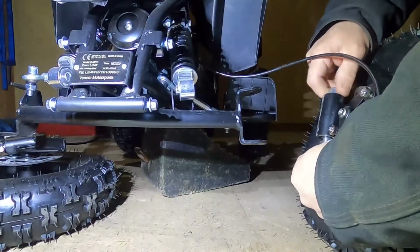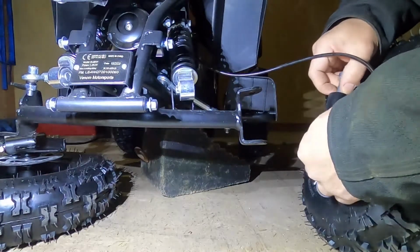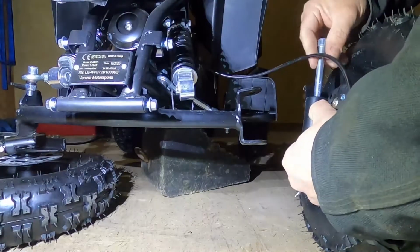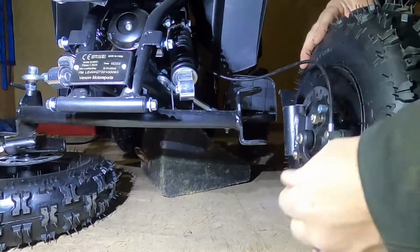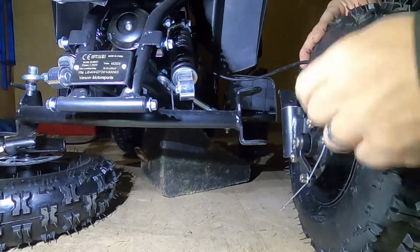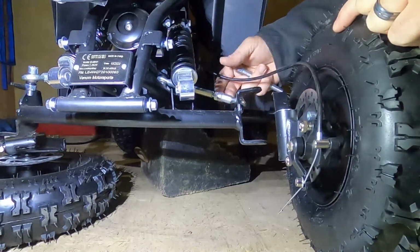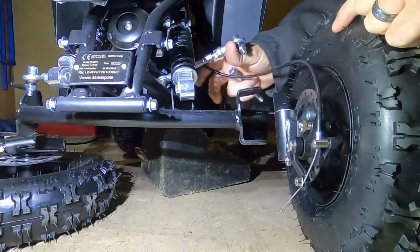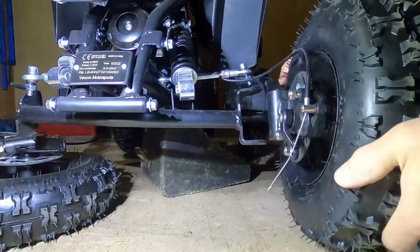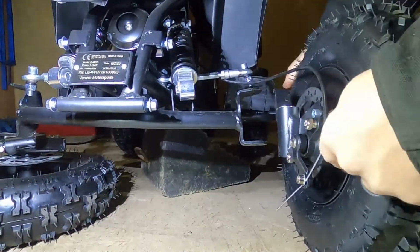The bolts are in here. The diagram doesn't show much, but it looks to be that you're going to want to keep the brake cable, which is the only thing holding these front wheels together when you pull it out of the package. This model, they're cable brakes. The larger model, they're hydraulic. I think, if I look at the picture, it's going to go behind your steering linkage. So get this up supported. I got the wheel chock I keep in my trailer. Make sure you put this on the right way. Steering linkage tab will be to the back. Your brakes will be to the front.